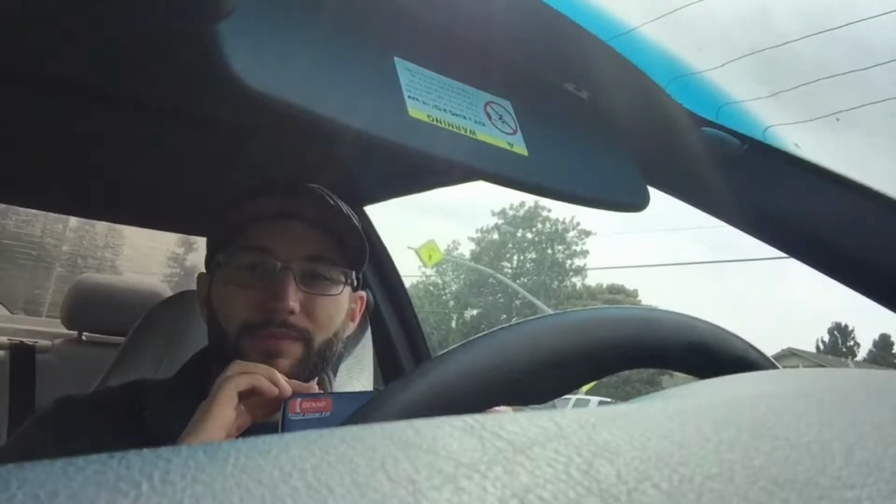And we are going to be replacing an oxygen sensor. It's a narrowband sensor, the stock sensor on the SAAB today, because after installing the bung, there's a check engine light and we're in limp mode. It sucks. It basically just means the car doesn't want to give us more power because it's too afraid to lean it out or not give the right amount of fuel and potentially do permanent damage to the engine. So, to undo this, we are going to be clearing the code today.